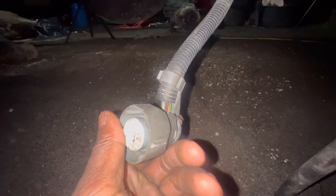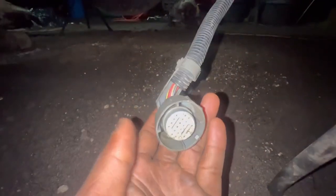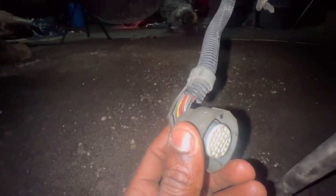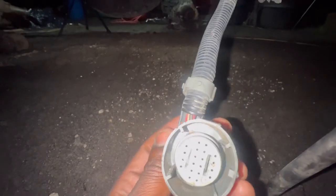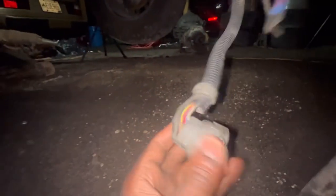While we're under the vehicle and while we let those two little brackets get painted, I'm going to rewire some of these wires. Two of these wires are going to go to a pigtail that I'm waiting to come in, and it's going to go to the input sensor on the 4L80E. The 4L60E, I think, only has an output — that one has both the input and output.